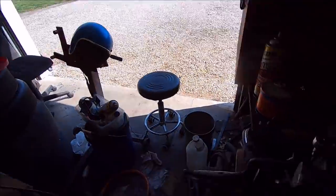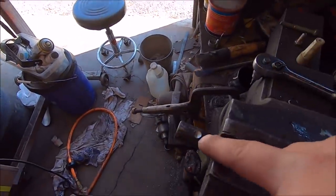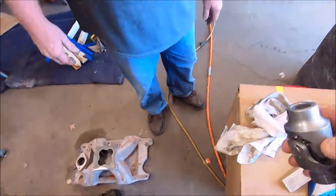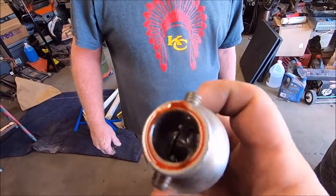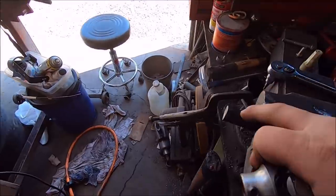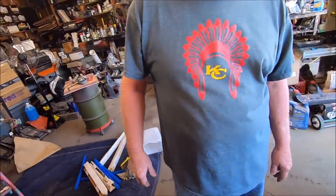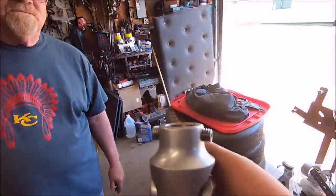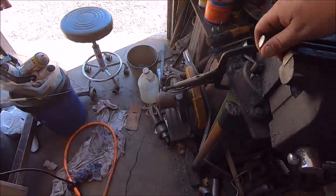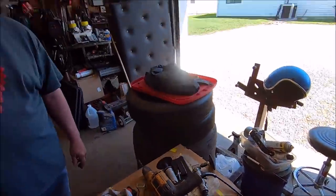So, as you saw, we cut it and staked both sides of it. Dad drilled and tapped that, and it's going to have a set screw on either side, a bunch of red Loctite, and those will lock into there, and Dad feels safe with it. Still where I can see it's tack welded, but Dad put his foot down. I say no welding, because this needs to come off if it needs to be serviced. So we're going to put more red Loctite on this, clean it up, let it set up, put it in, and hopefully it's still the same size.